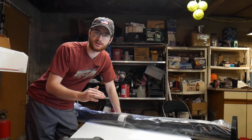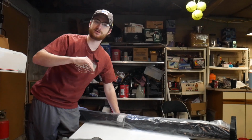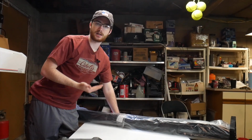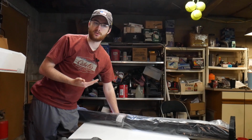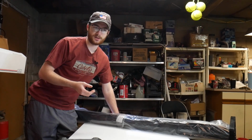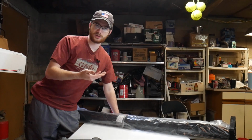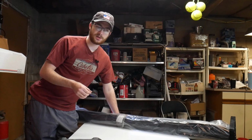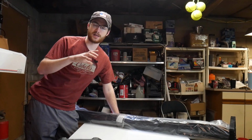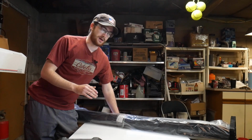Whenever you're cleaning your surfaces, make sure you get all the way around the edge, because that's where your vinyl is going to wrap around and tuck in. If it's dirty back there, it won't adhere right, and in a year or so, or 3 months, whatever, it'll start peeling up on the corners. So make sure you get the top of the surface, the edges, and a little bit behind the surfaces pretty good and wiped down.